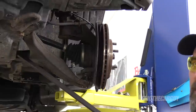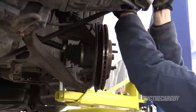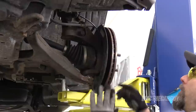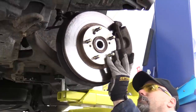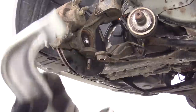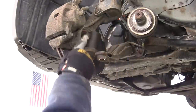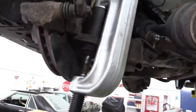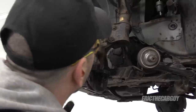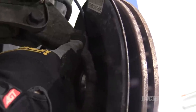Viewers have sent me suggestions where they have a rig on a pry bar where they can go underneath the control arm with something strapped over the top rather than going in like I am here — I thought that was pretty clever. I'll pull the axle out. This is where not having it hooked up to the tie rod end is working in my favor. I've done some thinking and I've decided I am going to take this knuckle assembly up off of here. My main concern is going to be this ABS sensor — I've got to be very careful with it. It's plastic and it can break easily. Once I get this up out of there I feel like I'm home free.